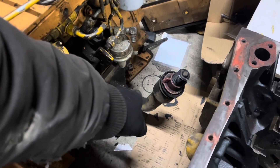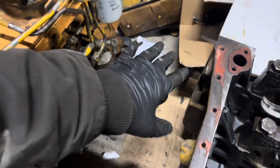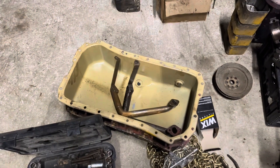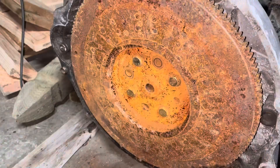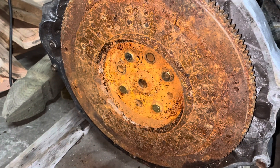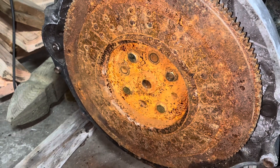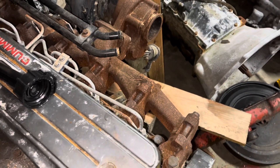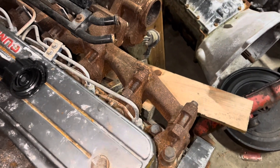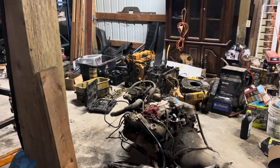Here's an oil fill — it's from a different engine too, but it's on there. I don't know what this is all about, but I'm not going to worry about it. I do hope there's a whole bunch of oil pan bolts in here somewhere, but I kind of doubt it. I was as shocked as you probably will be that my local parts store had Cummins flywheel bolts in stock on the shelf. Most of my experience on these is on VE pump engines and 24-valves — you don't get to play with P-pumps a whole bunch. I was interested to learn the return line goes right back into the feed, and I was hoping I could do that on that one so I don't have to run two new lines.